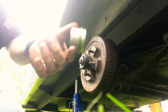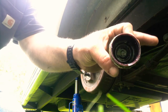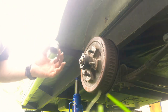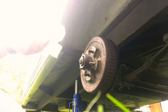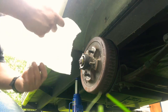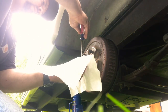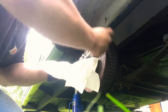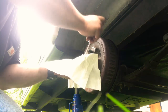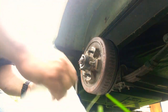All we're trying to do is get behind that lip on the dust cap. I don't think I cleaned it out last time I packed the bearings — it looks like I wiped it out but I didn't get it real clean. I've got some paper towels here because we're just checking things out, not packing the bearing. I don't want any gravel or dirt getting into my bearings.